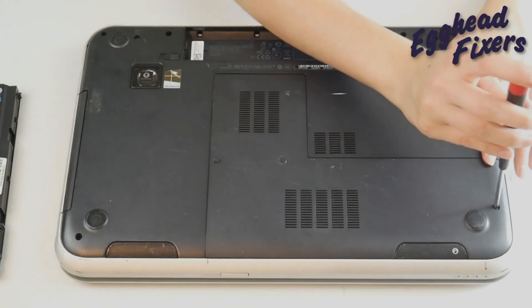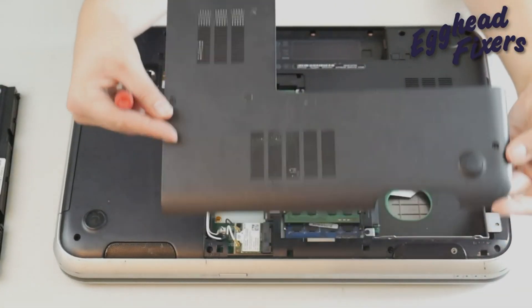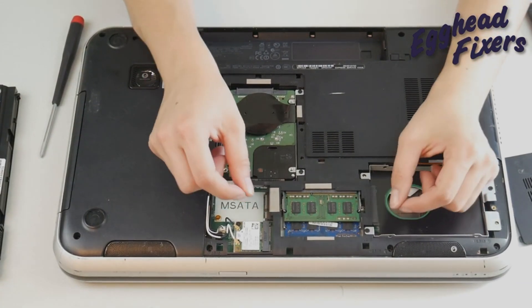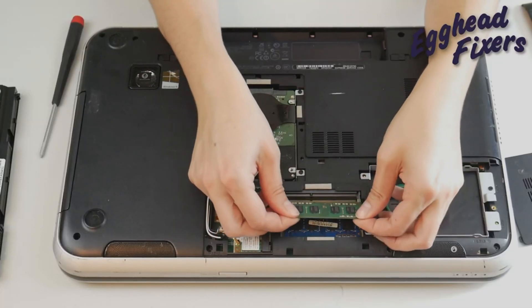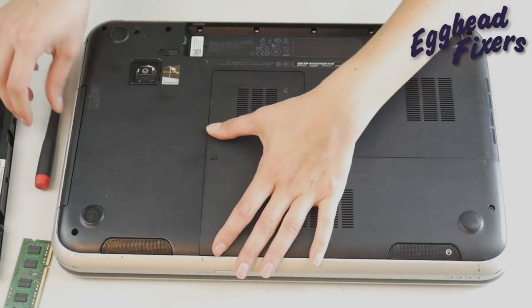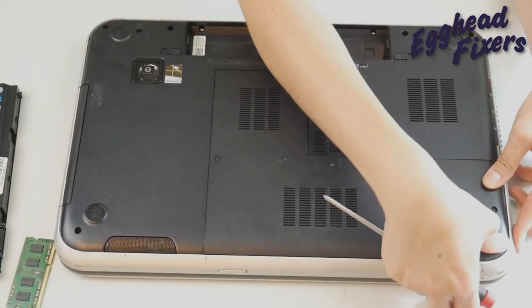I'm going to use the screwdriver to gain access — there's a link below for the screwdriver I'm using in this video. The first thing I'm going to do is remove that first stick of RAM. I'm going to pull outwards on both arms and it usually just pops up really easy. RAM is like headlights on a car — they tend to go one at a time. So if I take one of the sticks out, close it back up, plug it back in, and hit power, and my blue screen error is gone.